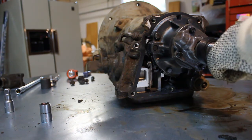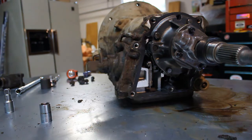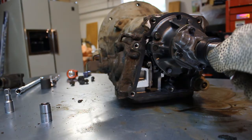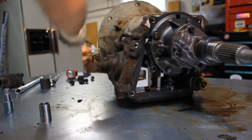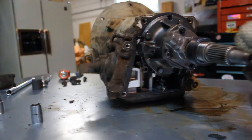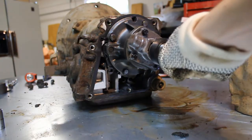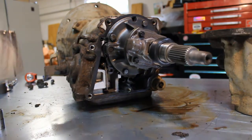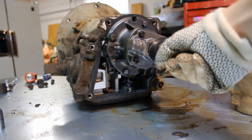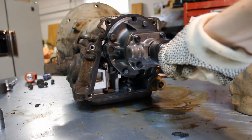So that's why sometimes, if you put your car in park and don't use the emergency brake, it'll roll forwards or backwards a little bit and then stop suddenly. Because as you roll, your drive shaft — assuming it's rear wheel drive — is spinning this. So, move it out a bit, back in park. Don't use my emergency brake, turn the car off, get out, it rolls forward, and then it stops.